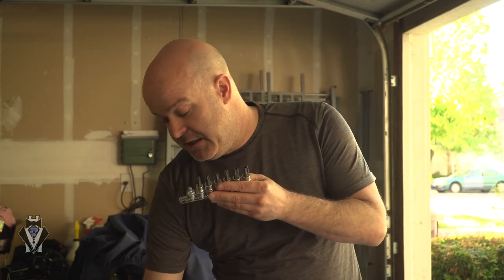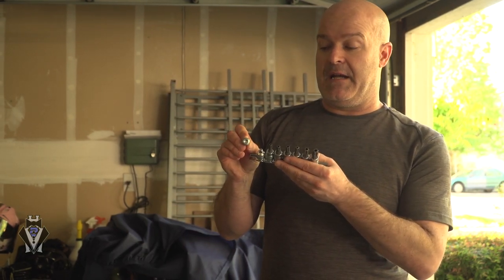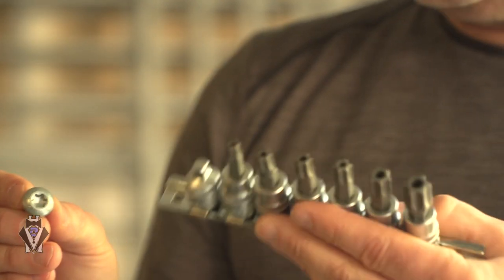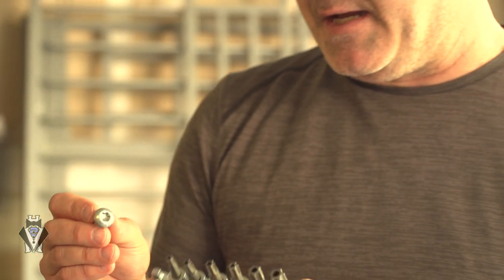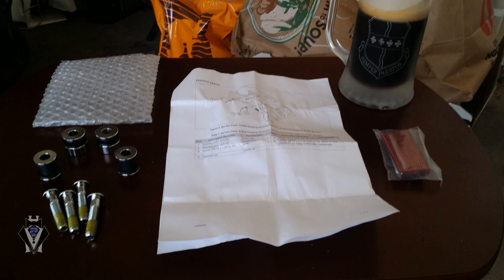The reason you're gonna need those is the first thing you have to uninstall for the docking kit are the screws on the fender mount, so you're gonna have to take those off. It's really good to have because a lot of Harleys have these star bolts anyway, so I just purchased a set because you're gonna need them eventually.